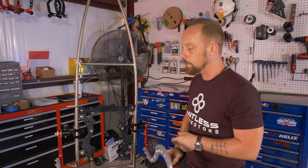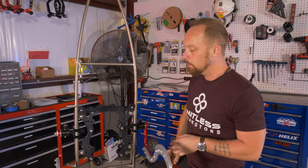It's really quite interesting. So again, up and down, as you'll see here, this clamp opens up. You can move up and down, in and out independently. Both sides are independent, and I'll show you exactly what that means and what you can do with that independent movement. The swing arms have some adjustment here. Obviously, there's 1, 2, 3, 4, 5 different settings here. This mostly applies when you're on speed bar and that seat board is down and your leg is pushing against that seat board. When you're on speed bar, you can offset one of these claws, we'll call them, and that'll give you a bit of torque compensation while you're on speed bar.